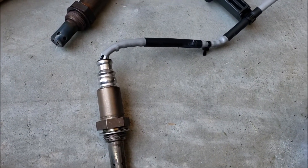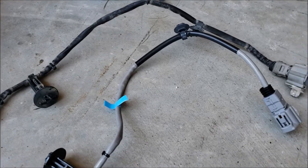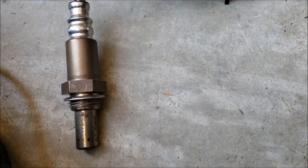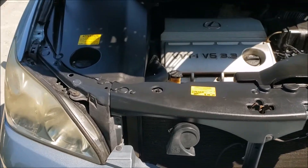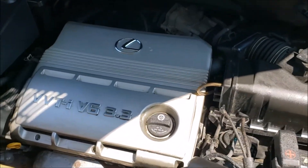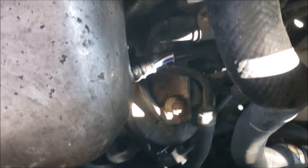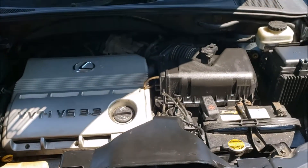It was much easier to get to. With the O2 sensors behind the cats, they can be a bit tighter due to rust and heat cycling expansion, so you'll want to use a breaker bar — that's what I did for the O2s. Another thing: these Densos come with a little tube of anti-seize — definitely use it. Everything is put back together. I cleaned up the engine bay a little bit, put some 303 on there, and cleaned up the engine cover — it was looking pretty nasty but looks significantly better now. All air fuel sensors and O2 sensors are in place.